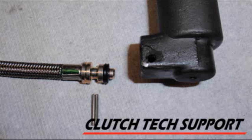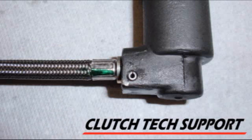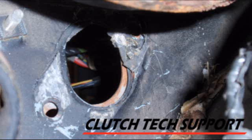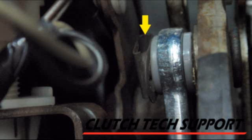Insert the new seal on the line. You can only use brake fluid as a lubricant — don't put any grease or motor oil on that fitting. Insert that fitting into the master cylinder and tap the roll pin into position. This assembly can then be inserted back into the hole underneath the brake booster. It's a little bit of a snug fit, so be patient. It bolts back up to the pedal cluster assembly, and there's a clip again for the push rod on the pedal arm.